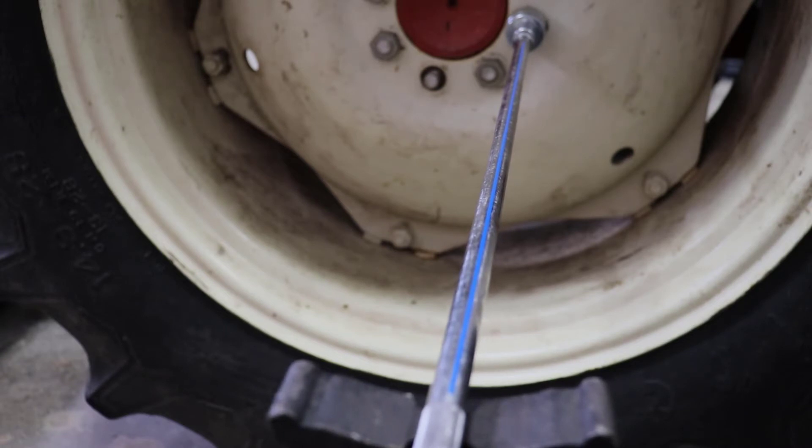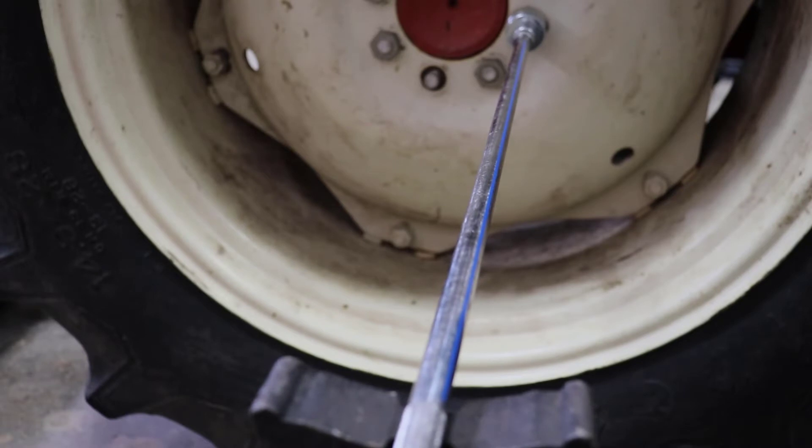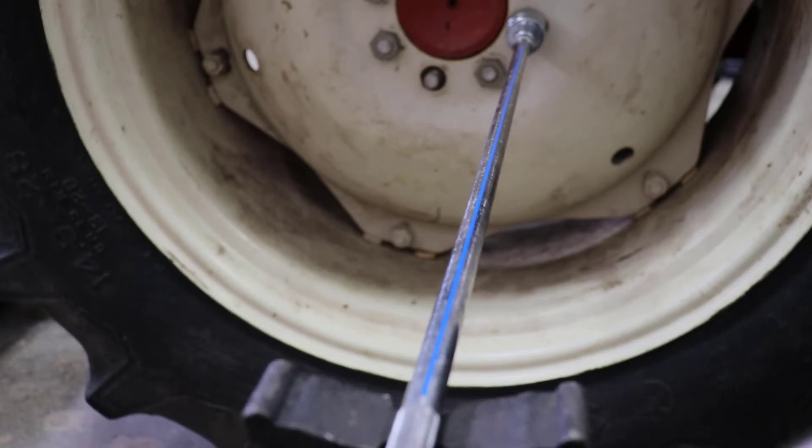So that's what's happening in the crankshaft — it bends every time a cylinder fires. The cylinder fires, pressure builds, the crankshaft twists, the piston pushes down accelerating that crankshaft. Then when the exhaust valve opens, the pressure in the cylinder drops to zero and it pops back. So: cylinder fires, pressure builds, crankshaft twists, exhaust valve opens, pressure drops, and the crankshaft springs back to its original position.